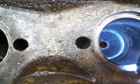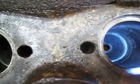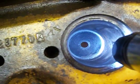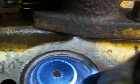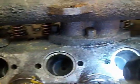I don't know if it actually cooked out or something got in there and hammered around and did that. I know this is a glow plug engine. I just don't know if a glow plug could somehow do that. So I'm just sort of looking for some feedback. This is cylinder one. This tractor did have all brand new glow plugs in it whenever I bought it, so they were obviously trying to get it running. And whoever's following this can tell that it's not going to run as the blown head gasket and other issues have come across.